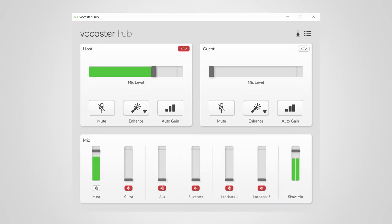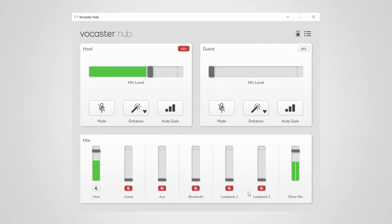Let's have a look at the software. As you can see it is relatively simplistic compared to some other interfaces — that can be a good or a bad thing. On the plus side it's really not too complicated to get the Vocaster to do what you want. On the top left you get controls for the first microphone input, which Focusrite calls the host — here you can set your gain, check your level meter, and access functions like mute, auto gain, and the audio effects. The same goes for the second mic input, found under 'Guest' on the right side. I tested the auto gain feature — the interface makes a short recording of your voice and sets the level accordingly, landing at roughly -23 dBFS. That's a tad lower than I would personally set it, but it provides a nice amount of headroom. At the bottom you have your mixing controls with full control over how much of each channel you send to your output and record, and you also have the possibility to include a loopback, which is helpful when you want to include your computer's audio.